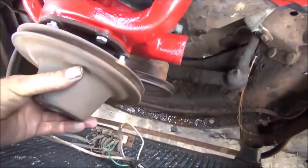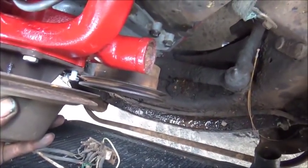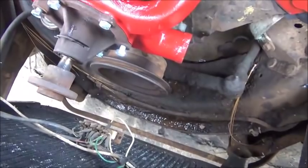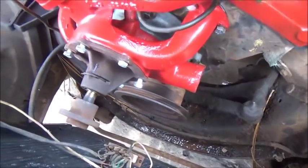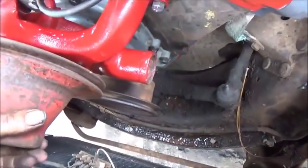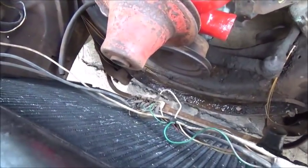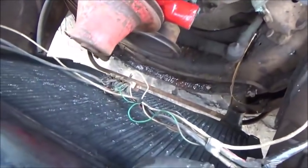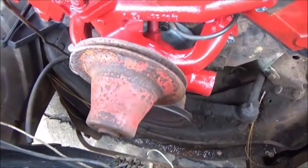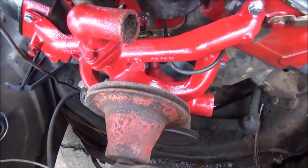he's right. When you put this on, the water pump must be, I don't know, an inch and a half long or something. But I found something else in the trunk. And this must be off of a Packard or something. So this one lines it up. Puts my fan farther forward, but it don't hit the radiator. I don't know if we're gonna be able to clear the shroud yet, so we're gonna figure that out. But that will work to be able to run it. So we'll get this pulley cleaned up and get it on, try to get a belt on it, and we got to get hoses and get water in it before we run it much.